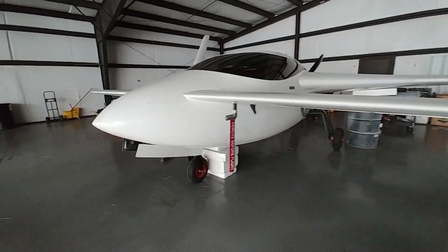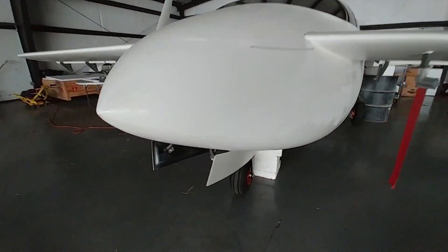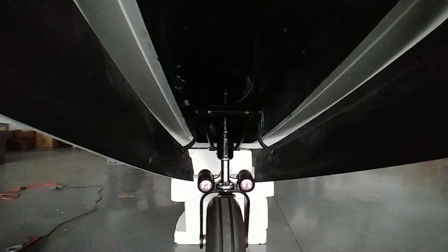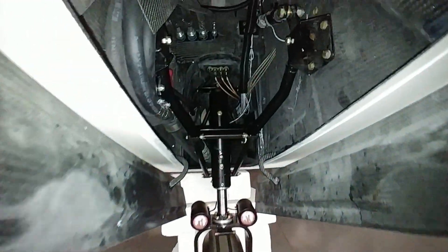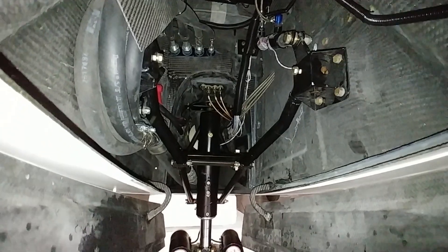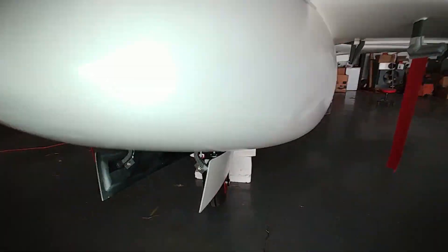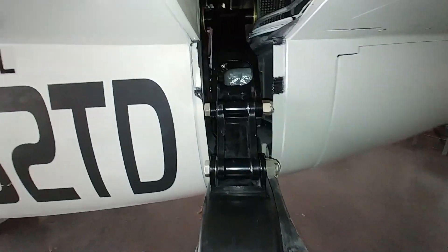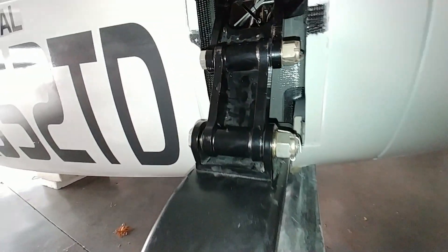The other thing I'm working on while I've got the aircraft back on the blocks is making the changes necessary to the mount point for where the hydraulic cylinder actuates the nose gear. I have to shorten where that hole is — shorten that retraction arm up on the right — and that will make the gear retract fully after I change that geometry to make it vertical.